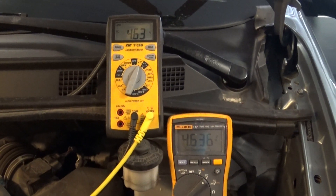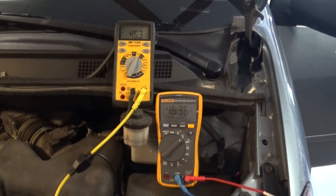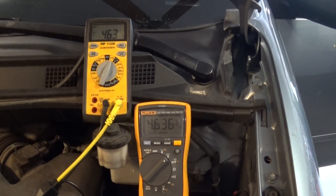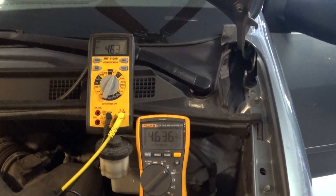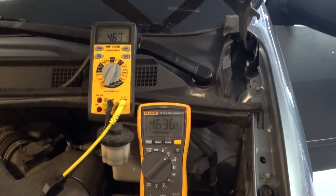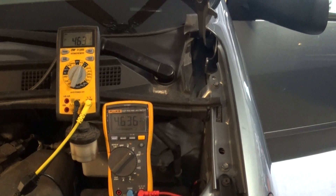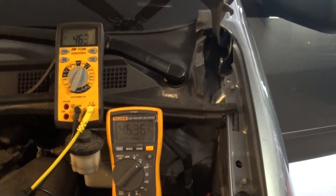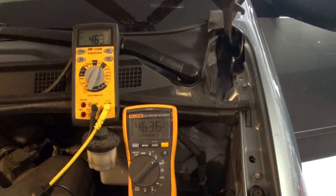To confirm: bad front right wheel speed sensor. Each ABS module is going to have some kind of bias voltage. This sensor makes its own voltage — it's a variable reluctor that makes an AC sine wave. You could see there was an open in the sensor itself, and to confirm your wiring from the sensor to the ABS module, the bias voltage comparison is the best method. One more note: when I unplugged my front left sensor to test it, that will set a code for the front left as well — but we know we induced that code, so that's okay. Thanks for watching, see you next time!